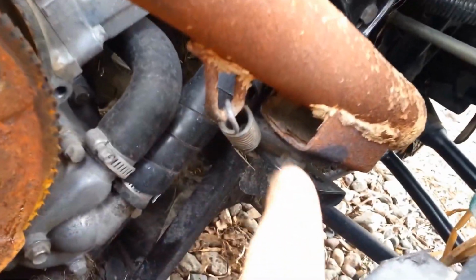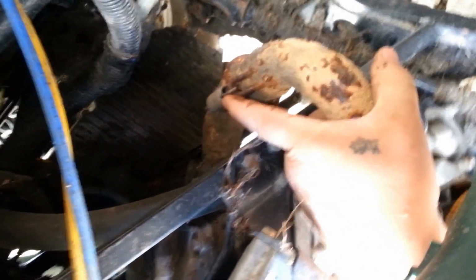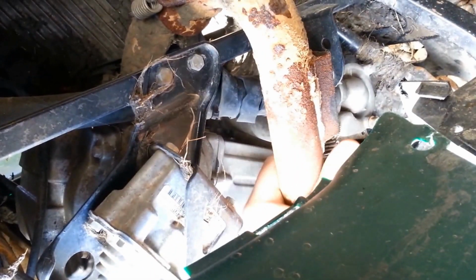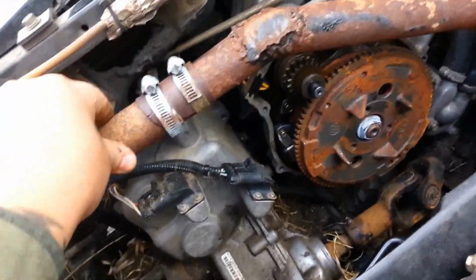You come up to the front, you've got one spring that hooks here, and then behind your front tire, if you can see, there's a spring here that hooks to your header. That has to come off, and also one on the bottom. So you've got three springs: two in the front, the one in the middle, back here, and then two in the back. You take those springs off, and you should be able to take this whole tube out. It'll give you a little more room to work on it.